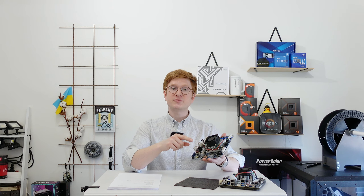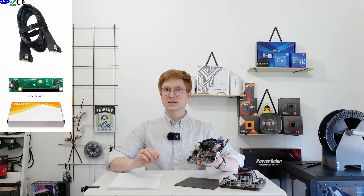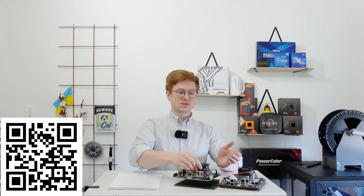What's not so nice is that with this motherboard we have the slimline X8 connector, and in the BIOS I could not find any PCIe bifurcation options. So even if you manage to convert the slimline X8 to an M.2 or PCIe X16 slot, you can only connect one device. Ideally I would want to split it into X4/X4 and connect two devices. I have seen online that the official EC0 version does have PCIe bifurcation options, which was one reason I wanted to try the official Gigabyte BIOS.